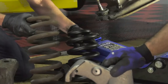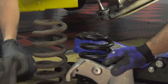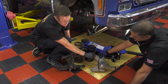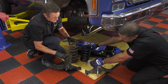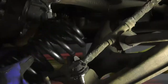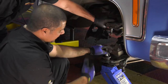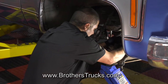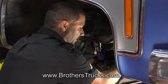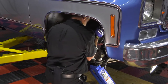As you can see just in the height of the spring itself, it's a much lower spring that's going to lower the vehicle down and give you a better ride quality with a little more high performance. You can see how much higher the spindle is located compared to where it connects to the truck — it's pretty much five inches of coolness. It has a progressive spring rate, so if you're having a spirited ride going around corners, it gets stiffer as it bounces and works. Let's put them on — quit messing around and get to work. Once the spring is in, make sure the bottom is in its pocket and the top seats in its pocket too so the spring stays stationary. Have a buddy work the jack while you keep the spring in place, then put the knuckle back.